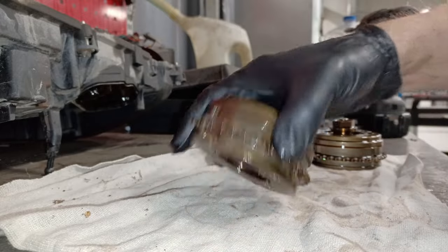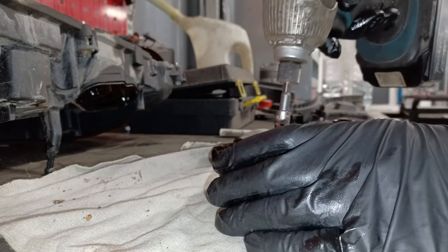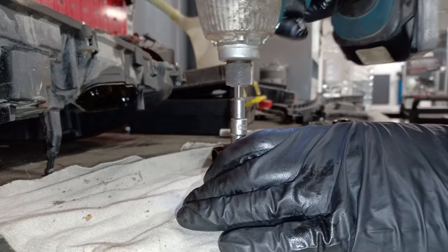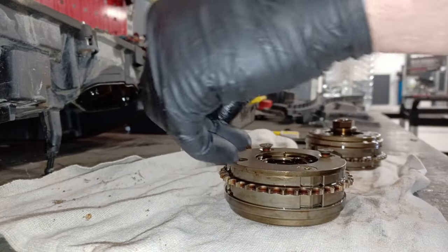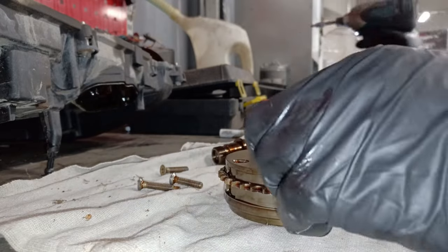So what we'll do now is look at this exhaust Vanos and open it up and see if it's snapped the wing tips off inside. I don't think it will have done on this, actually. But it might have done. Now, the spring's going to release in a minute, so don't be alarmed. What? Spring's just gone. Really. You'll never get this back together. It's scrapped now. But we've got new ones anyway, so everyone's happy kind of thing.